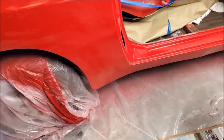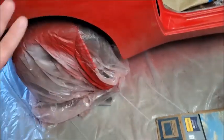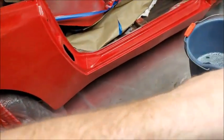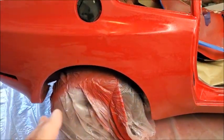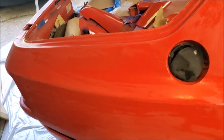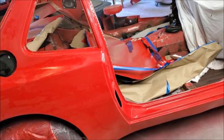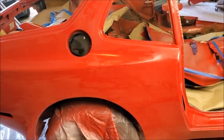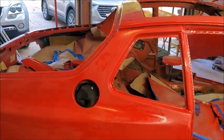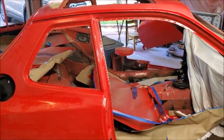All right, so I have sanded the car, the body of the car, that's all I need to redo, with 600. I had some Dawn in there, so what I did was, after that, I dumped it out, washed the bucket out, and then grabbed a clean rag with some clean water, and then just wiped that off. I'll degrease that, and I'll tack that, and then I'll try to put some more clear coat on tomorrow. But, yeah, so I guess I could start taping. There's one of the things I could do because I'm going to have to tape everything off again.